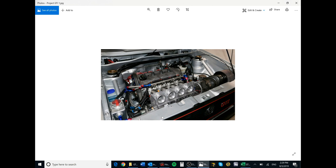It has 288-degree duration cams with a 105-degree overlap — fairly tight overlap — and it idles well with these ITBs, individual throttle bodies. When I put the airbox on with the large air filter, I get clean air for street use and engine longevity, but it does interfere slightly with airflow around the intake trumpets. The engine was dynoed in various combinations: it produced maximum power of 205 horsepower at the wheels with the airbox off, and was down around 10 horsepower with the airbox in.